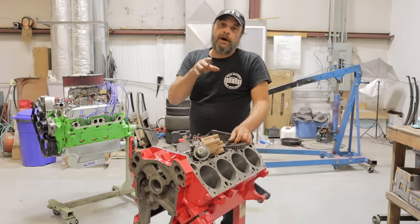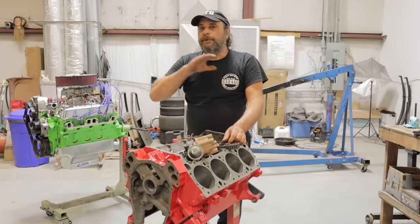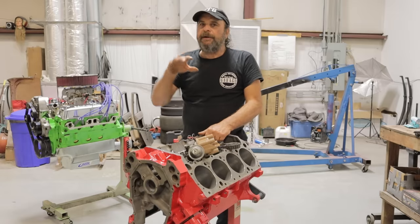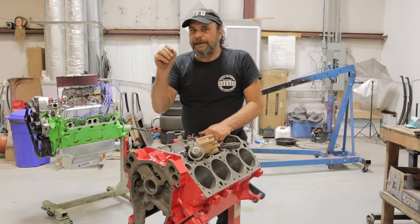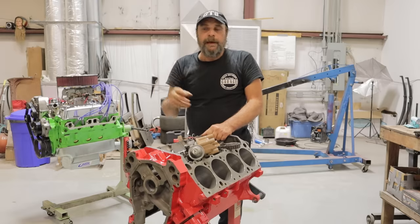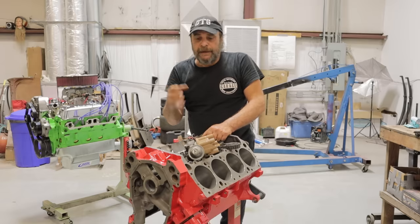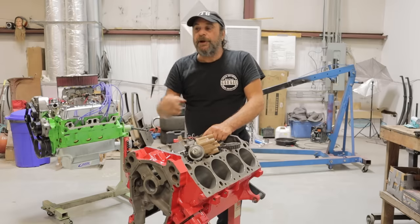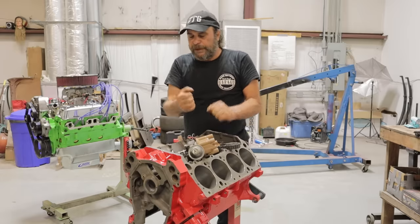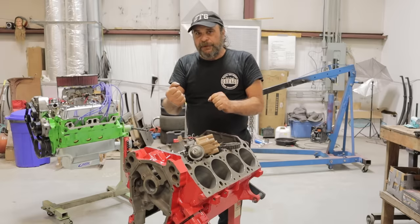John's car — when we took it for that initial ride, I told him it's running on seven cylinders. You could feel it; it was very pronounced, right on the edge of being a dead miss. But after I gave it that little tweak with the distributor to advance it, it went away. One of the cylinders' dynamic compression ratio had dropped to the point that the ignition timing wasn't sufficient to get good power out of that cylinder — it was just kind of going through the motions. When I advanced the timing, that was enough to bring that cylinder back to life and the motor smoothed out completely.